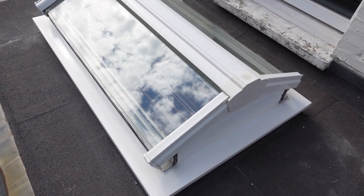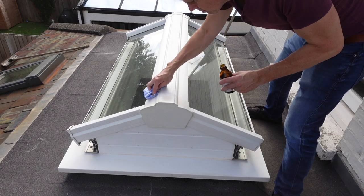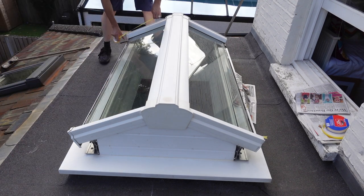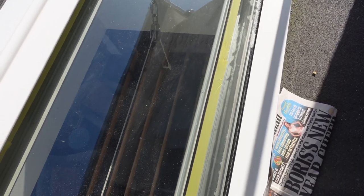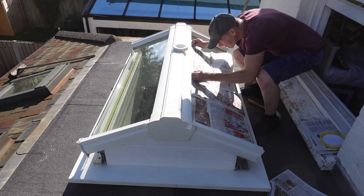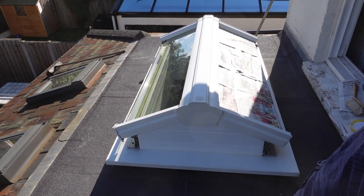I've cleaned up all the bits of plastic. I'm using Surgical Spirit as a degreaser just to get off any grease or oil that may be left on the surface. I'm going to mask up this area so I don't get any paint on the glass. I've masked the edges up now. I'm just going to put some newspaper on the glass. I've put the painter's tape on first and then masking tape over the edges of the newspaper to get nice clean smooth lines. Now for the other side.